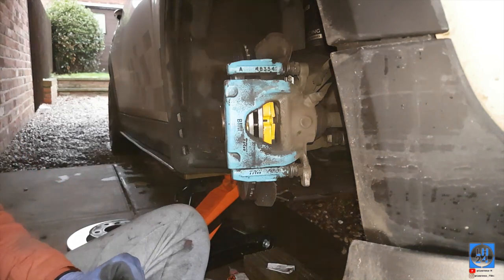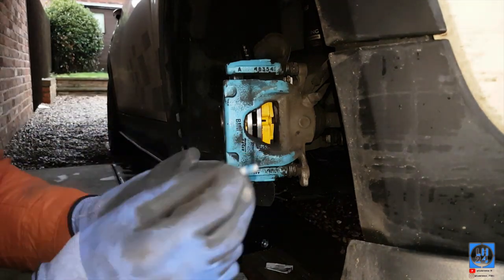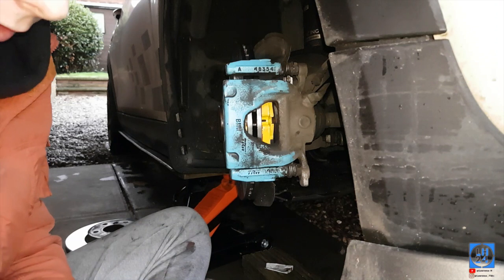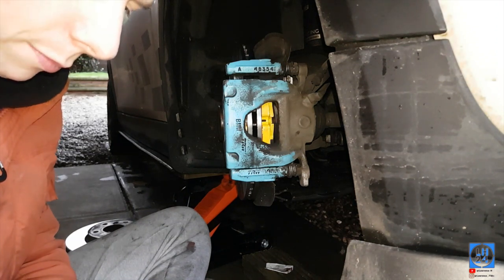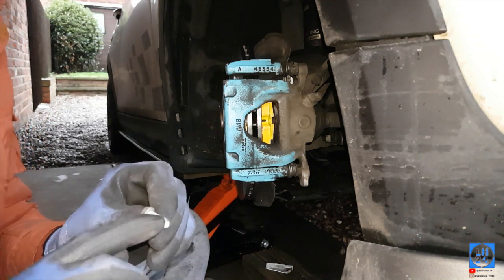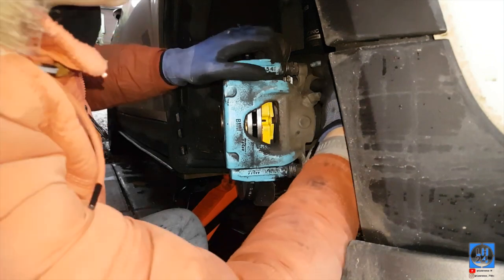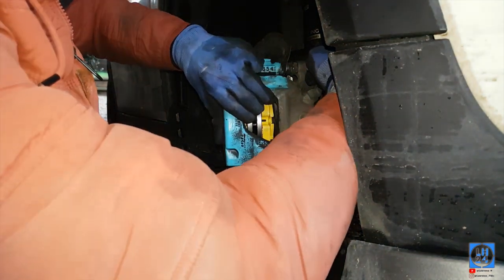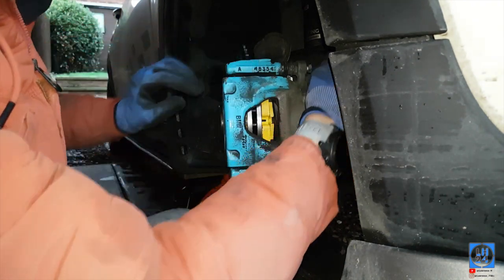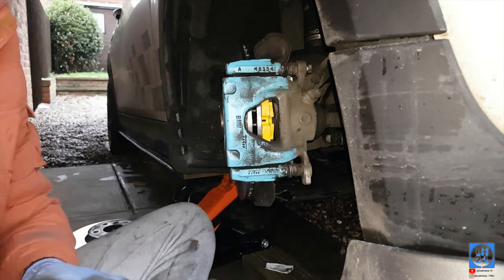Get your little bolt, put a small bit — not Loctite on this one, the old stuff will do — just always reapply a small amount of Loctite on the small bolt. Then wiggle the front of the caliper until it starts feeding through. These slider bolts go to 35 Newton metres. I'll wrap all the torque specs in the description below.